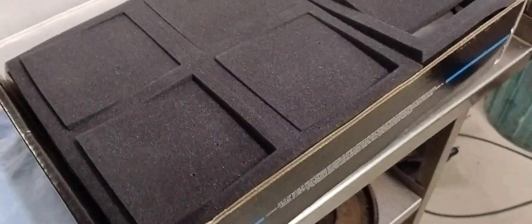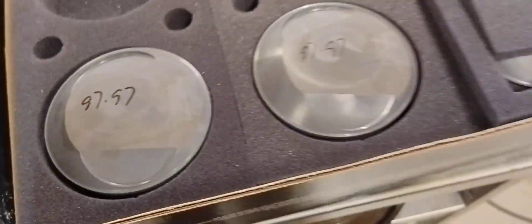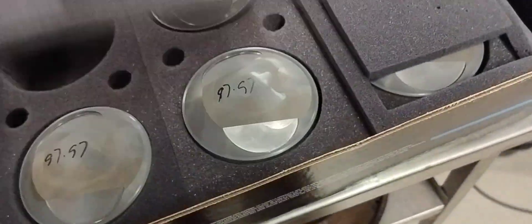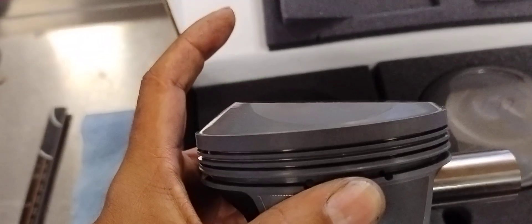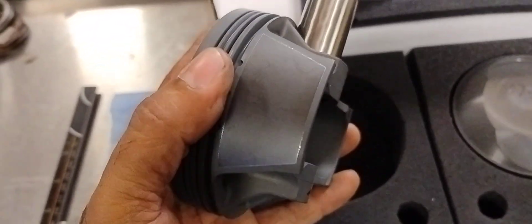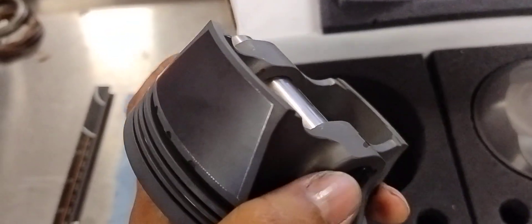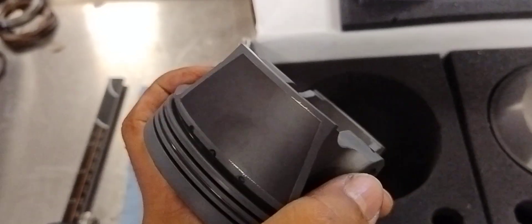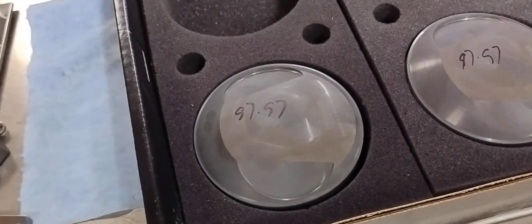The only change we're making is he's ordered some 98 millimeter pistons — I've been measuring them all just to make sure they're all within spec — and some larger cylinders as well, so brand new Mahle barrels to go with them. These are quite a nice piston; they have the wedge-shaped dome like the Max Moritz style piston, and they're coated on the skirts as well. The whole piston is coated with an anti-friction type coating, and the skirts themselves have a pad on them to reduce friction. Nice valve reliefs cut in and they've still got the wedge, so obviously make sure you mount these pistons the right way.